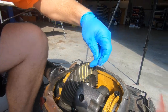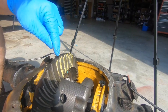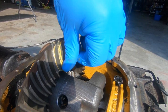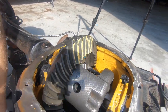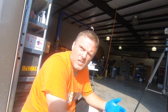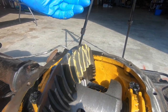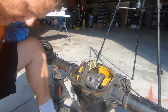You can see where the compound is wiped away — it's pretty centered, goes almost all the way down into the depth of the ring gear, and there's almost full contact across the entire surface. That is full contact and it's equal. Now we'll switch around and paint the back side to check that surface as well.